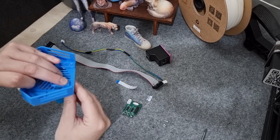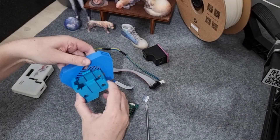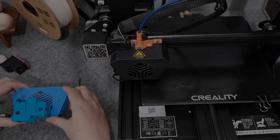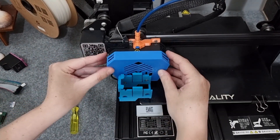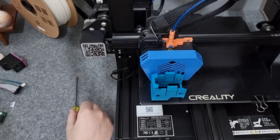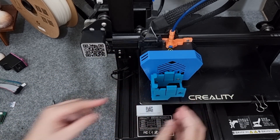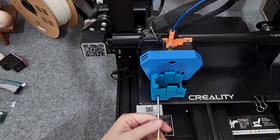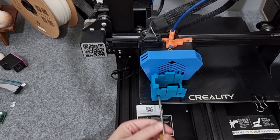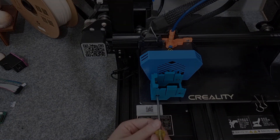We will be needing to adjust the height in a bit for calibrating. The cartridge housing should be able to move up and down. Do the same for the other side. Once done, put these on the printer's fan shroud. If the print head is not over the bed, slide it so that it is just hovering over. This is to calibrate the height of the nozzle and cartridge holder to the bed. Make sure the nozzle is set at zero, then make adjustments so that the cartridge holder is straight and level with the bed. Once done, screw tightly in place.